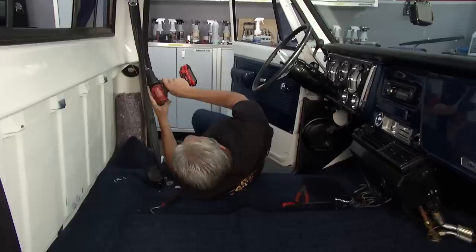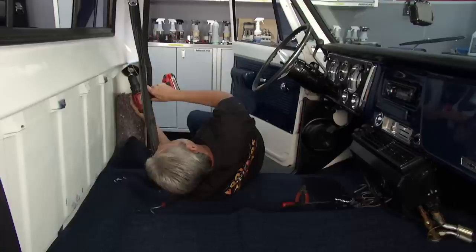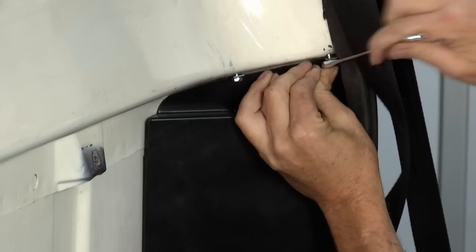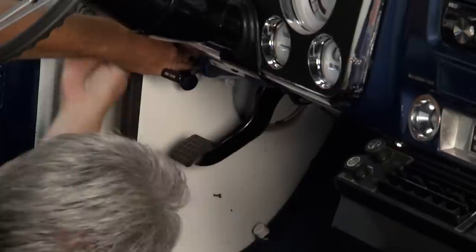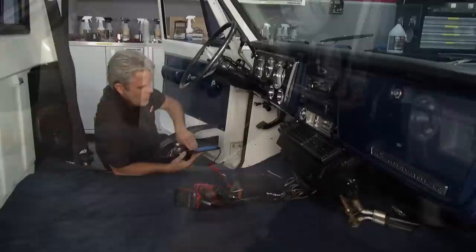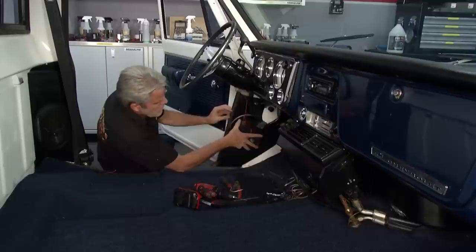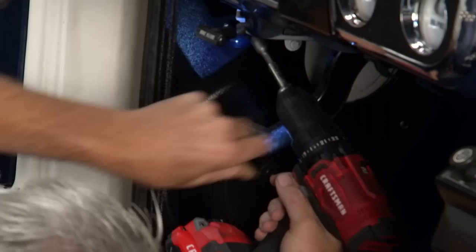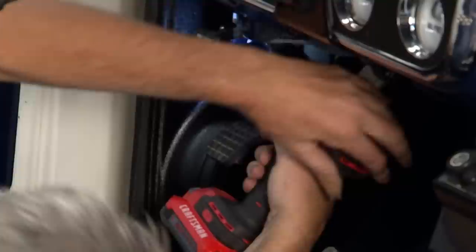To throw the speaker in, it's real simple — put it in, mark your holes, screw it down. Put the speaker in first, drill the holes, screw it down, put the cage on top, bolt it up, make sure your wires are clear and not on anything sharp, and you're ready to rock and roll. Moving to the front of the 1970 C10, these trucks have vents up near the driver's and passenger's knees, so take care of those vent handles first — just take them off, put the speaker up in there, trial fit it, put a self-tapping screw in the front and in the bottom to get it solid, then do the handle. It's a bit tough to hold it in place and do the handle at the same time, so secure it first.